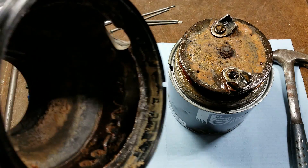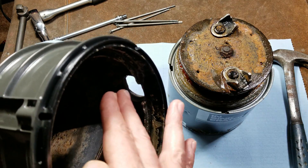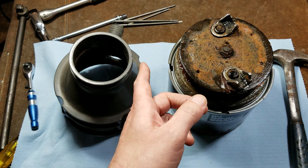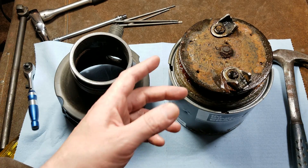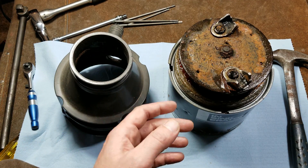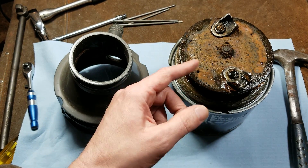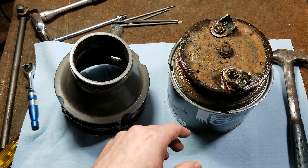The other thing to note is the positioning of where these teeth are in relation to the discharge hole. There's just a little bit of a gap between the top of this wheel and the very top of this hole, and what that does is ensure that no really large chunks can get through and clog your pipes — they have to be a certain minimum size to reach the discharge. Also, grinding larger frozen items ends up bouncing off the top of these teeth and puts a lot of lateral stress that can bend the rotor plate. That's where vibrations come from — every once in a while you run into a disposal that vibrates and that's what's happened.